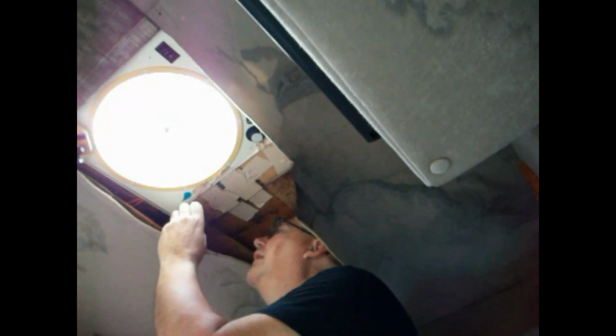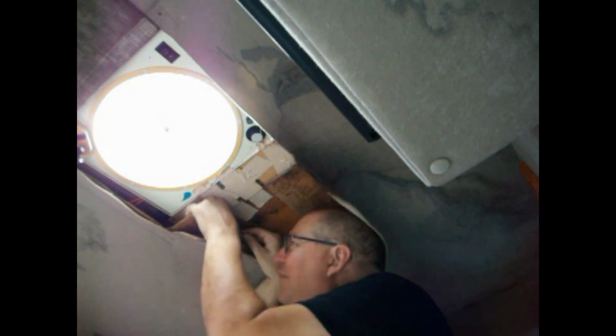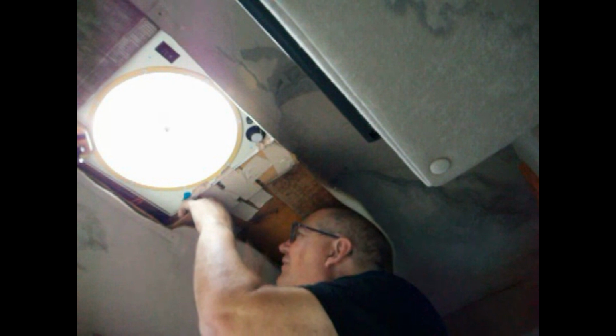And all the screws I pulled out of this thing have been rusty. Very rusty. Like gone. There wasn't any silicone sealing above them, or any butyl tape or Dicor to seal that gap up. And the other thing I found is with the hood vent, only one side is supported. It was made that way, so this side is flappy, and probably that's why there's so much damage right here. So let me show you what I've been doing.